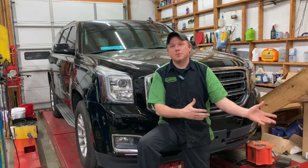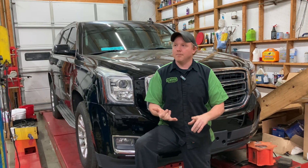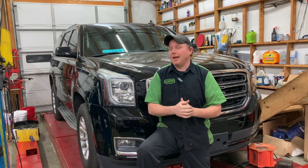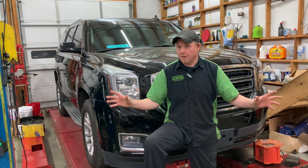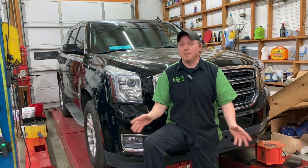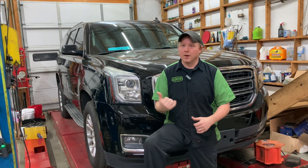As far as cost, they are pretty much all reasonable — again with the exception of Chrysler. It is just a constant money grab with them, whether that is AutoAuth or the three different subscriptions you have to deal with. They suck. When it comes to programming, it's really nothing to be intimidated about. Certain cars — especially Euro cars — you need to make sure you have a good hefty quality battery maintainer, because they tend to leave a ton of modules on. They're going to be drawing like 30-40 amps just with the key on and you will suck a battery down in no time.